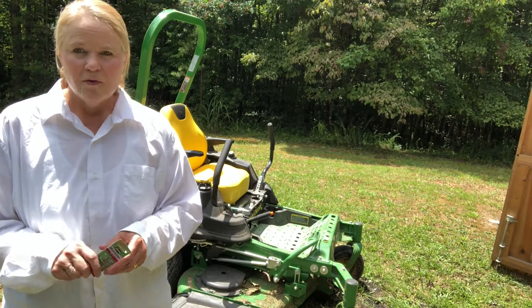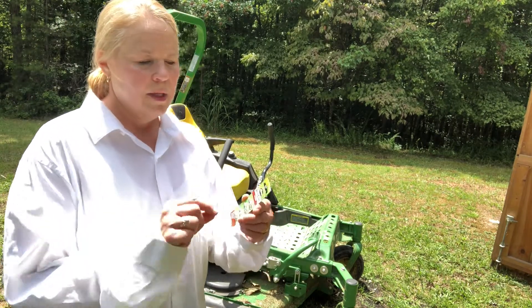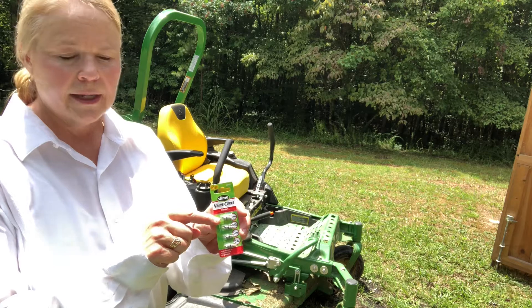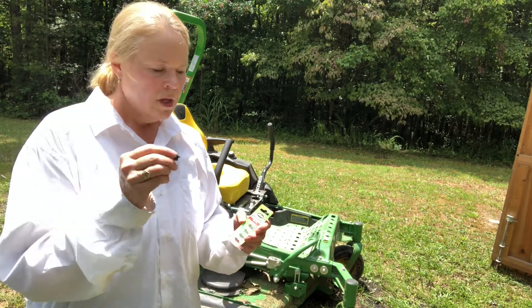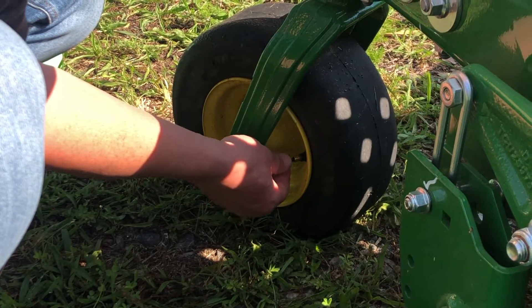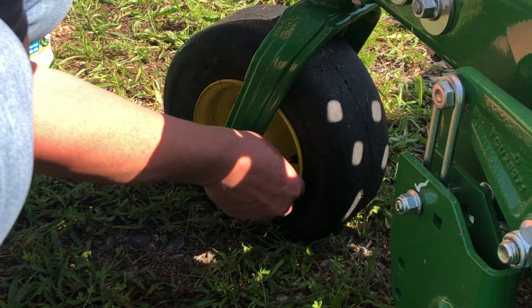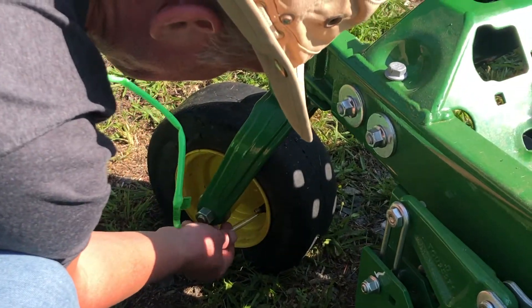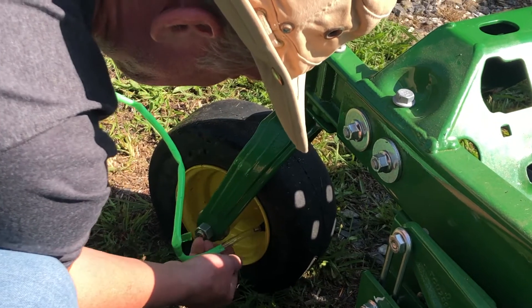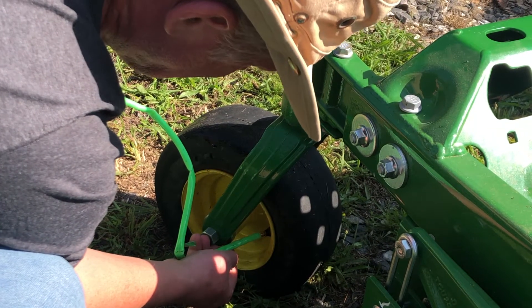Here's what you do: you take out the air of the tire, whatever remains, and then you remove the valve core. The air valve has this little core in it, and on the actual container of slime comes this little tool — you just pinch and twist and pull out the valve core. You have to pull the valve core out because the next thing is you're going to put this hose into the valve and pump it full of slime.